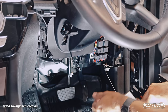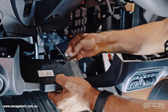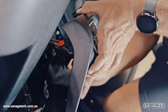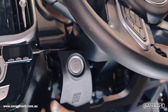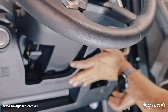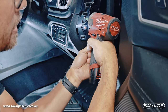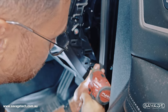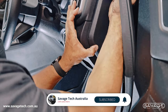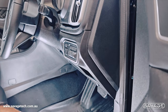Now we're going to get the panel and start plugging everything back in. One connector back in, clip the little alligator clip back on, plug your footwell light back in, plug your connector for the headlight switch back in — pretty much plug in everything that you just disconnected. Then line this up. I normally tuck the cable in on this corner, nice and neat, and click that back in so it looks neat. Clip all this back in — all done. Get our three Phillips screws and put them back in. Three screws back in where they belong. Pull the trim back, get your trim clip and little trim piece, put it back on, line it up, and it'll click on beautifully. Make sure all the trim's clicked in — and that's it.